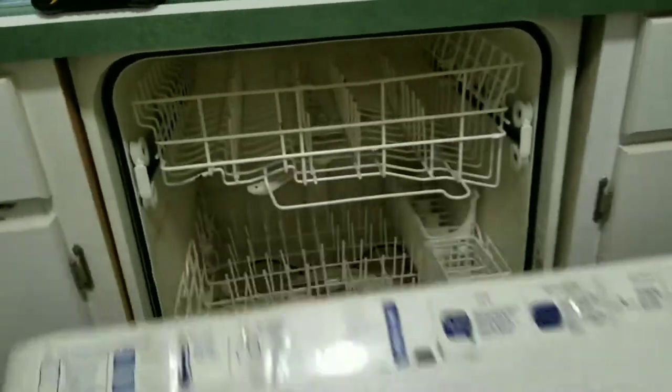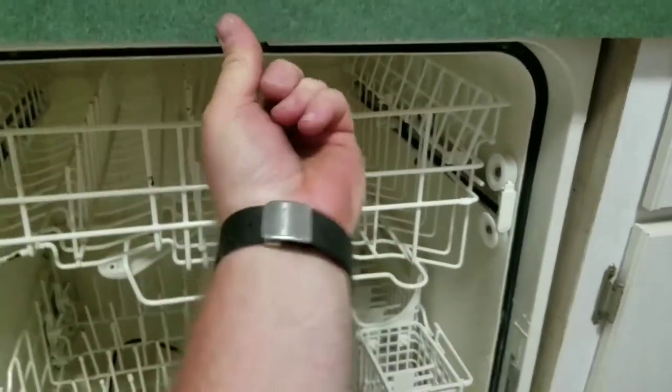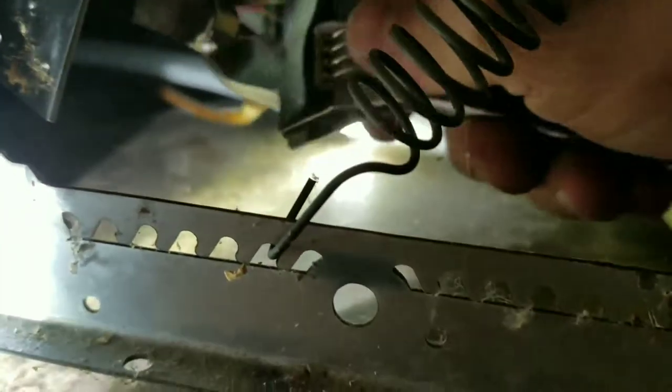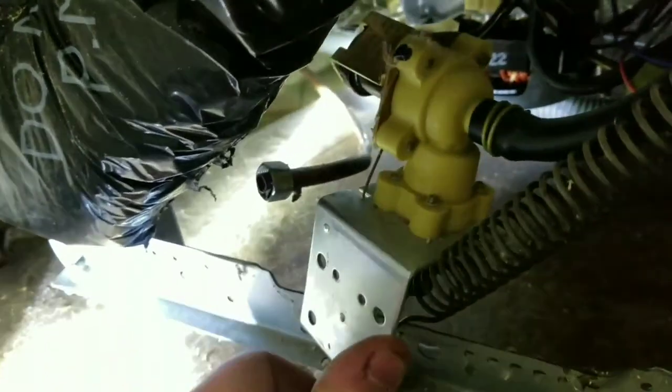Now this should be able to pull out, and then you can disconnect your hoses, your drain, and your electric. Might have to work it a little bit to get it to start. Anything you can grab onto to pull it out helps. I'm going to turn it kind of sideways here. I need to remove my water line right here and my drain. Get your wrench on here and try to break this thing loose. And you got this thing loose from the water. Now for the drain.